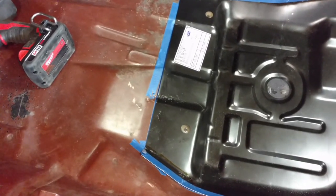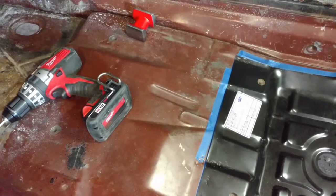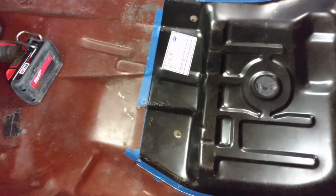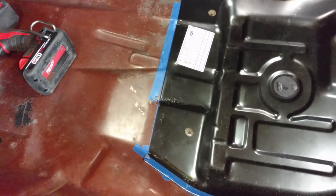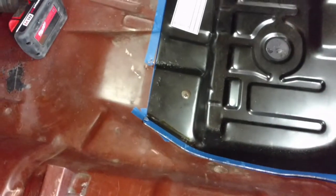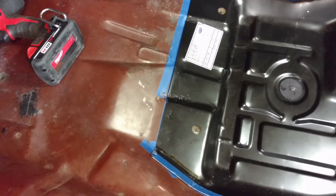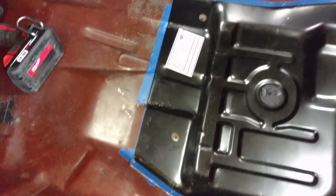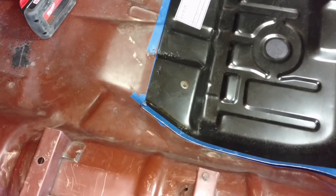I've been beating these into place, trying to make those edges a little bit sharper, because the original GM panels — the corners on the stampings of the sheet metal — were much more pronounced. These aftermarket panels are a little bit softer and everybody complains about that. So I thought the best idea was, while I still had some of the old curves in there, to use the blade on the hammer and get into the curves to make them match closer. That way when I go back and weld, they will match and I won't have as many problems.